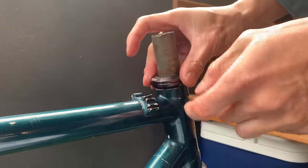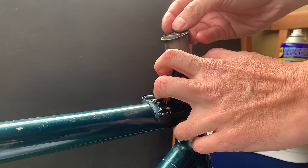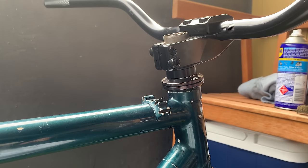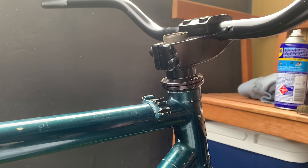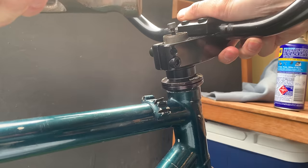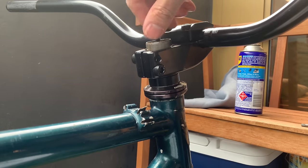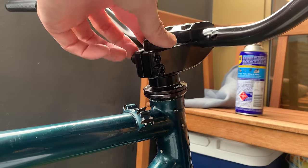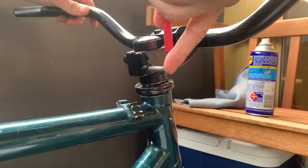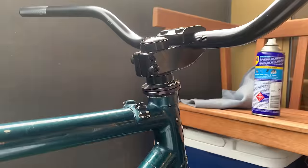The reason for the thicker tires — I want to make it kind of like a clunker style, fat tires but having a light bike should even it out. Should make it a pretty fun ride, and a little bit more plush with the rigid fork will help too. Installing the fork — putting grease on the turning areas even though these are sealed bearings, just to keep water out and stop it from rusting. Then greasing up each part. Once I put the stem on, just putting one spacer for now — I'll do this height and see how it goes, if it ends up too low I'll switch it up. When putting the bolt in it was a little crooked so I think the star nut was installed slightly crooked. Just straightened that out — makes clamping down everything a little bit easier. Alternate the bolts as you tighten with this stem — you don't want to strip those threads.